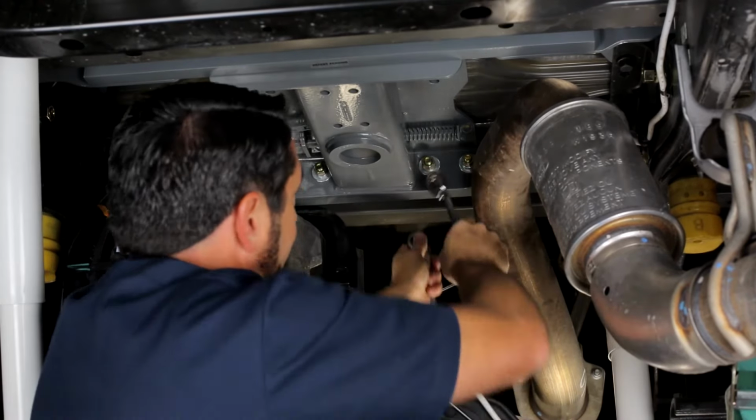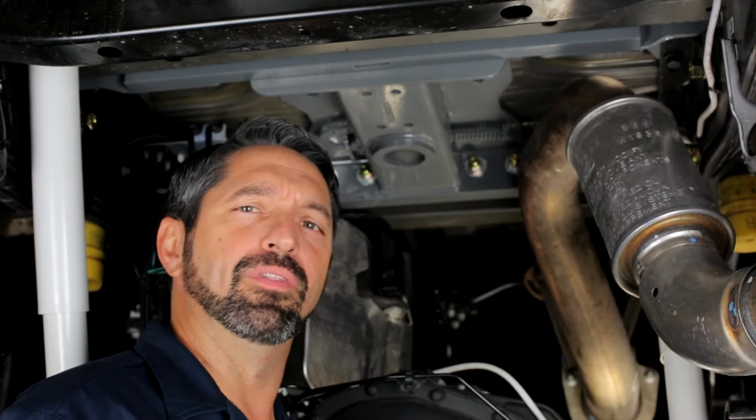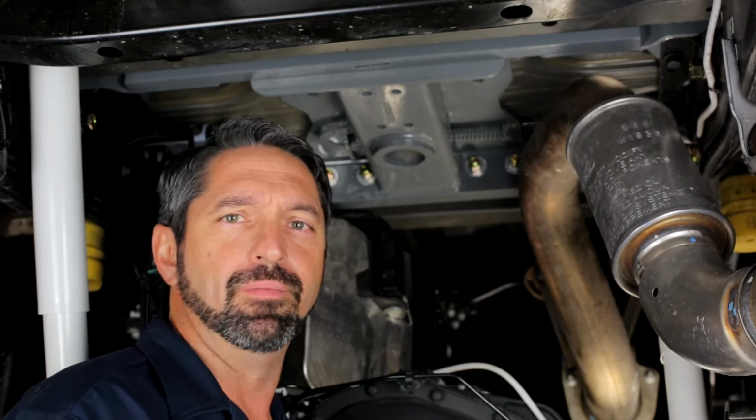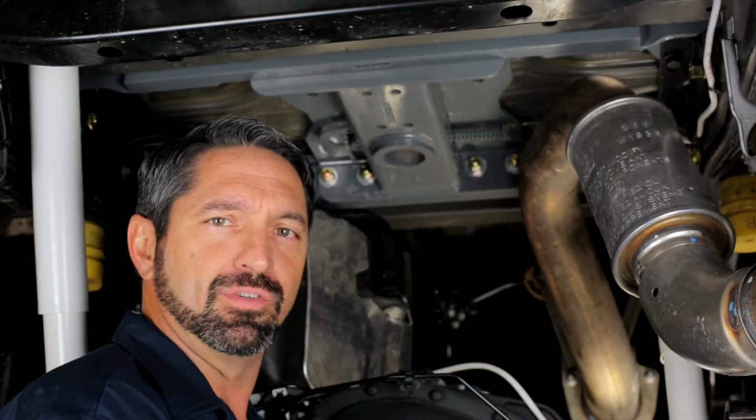cross member. The next step of the tightening sequence is important because it will determine the final position of the center section in the truck. It'd be a good idea to make sure that the collar of the center section is engaged in the 4-inch hole of the bed before you continue. It doesn't have to be perfectly centered, just make sure it's within the hole.